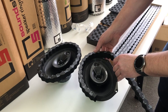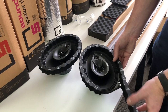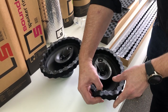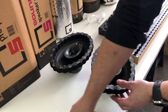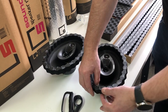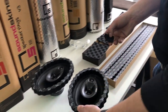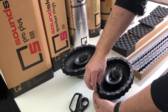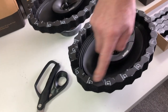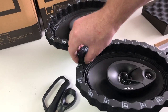The reason for the 27-inch length — let me quickly show you — if you're doing a 6x9 speaker, it's enough to go all the way around the whole circumference of the outer edge. You would just trim the edge to the size you need using a pair of scissors. The cool thing about these new SoundSkins version 3 rings is that if you need more distance or want to seal anything, you can stack them and they double up. The double-sided tape sticks very easily to the smooth face, and it will stay on there.